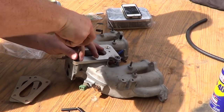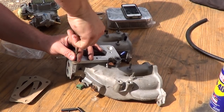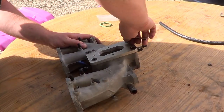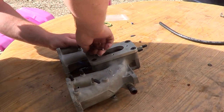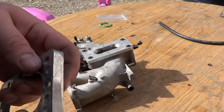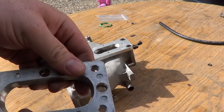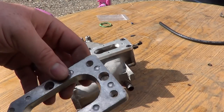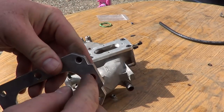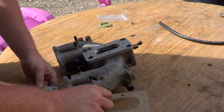These holes don't line up very well from the factory either. Once you're getting this one snugged down — don't tighten that too much. Like I said, you may crack it. On mine, you see that little lip right there? That's pretty much all that holds this thing down with the gasket. Do not over-tighten this, because I cracked mine right here by over-tightening it, and if it cracks around that you've got a vacuum leak.